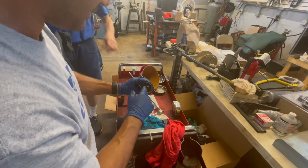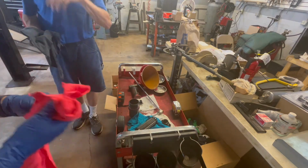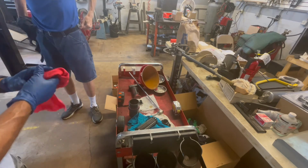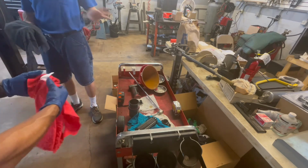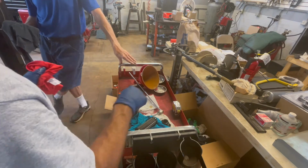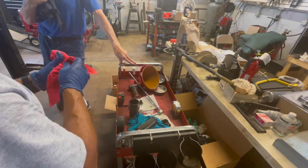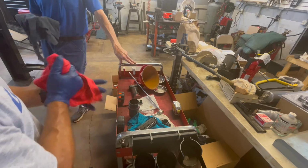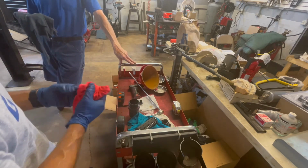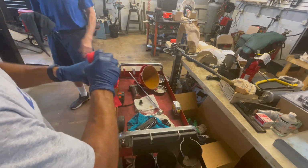With that plastic cage in there, as hot as it gets, that plastic probably gets soft. That's what I was thinking. That's where I think they had the engine failures, because they changed it and there was no explanation. They changed it, and then you didn't see the engine failures. There was never anything in the paperwork saying use this one, because our manuals still say use the other one. Yours says it? Mine does. My manual says 2062, because that's what was for your vehicles. Mine says FL-2087.